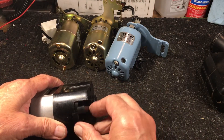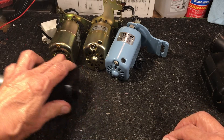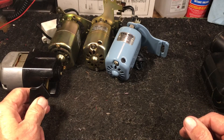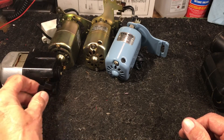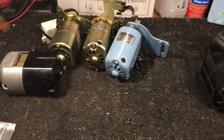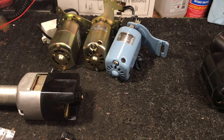If you have a machine that you've used a lot — and you have to use it a lot to use up motor brushes, they don't go too easily. I have customers who have used up two or three sets of motor brushes because they do that much sewing. They have an Etsy account and they sew all day every day, and they'll go through motor brushes. But motor brushes are cheaper than motors, so I would encourage people to replace your motor brushes. Rebuild your motors. If you can't do it, find somebody who can.